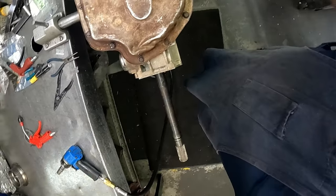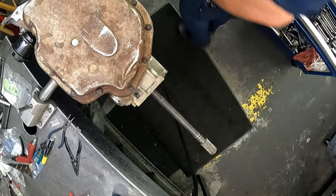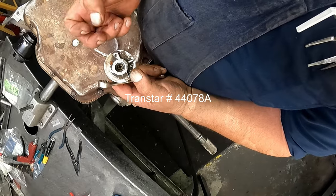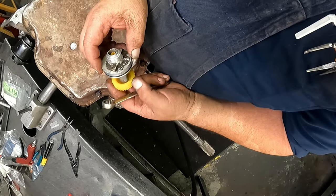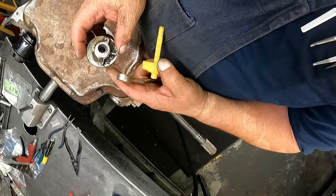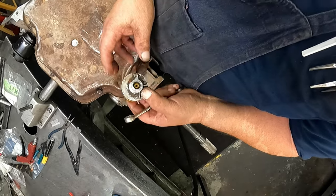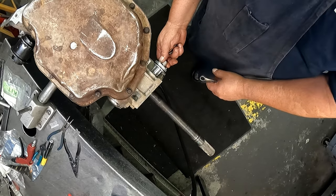We have a speedometer. There's a metal clip that holds that inner seal in there. They make a different design that presses in. It's a much better seal. I would put that in there. The O-ring here. Your housing has to match your gear, so whatever your tooth count is, this one fits a 40 through 43 tooth speedometer gears. You have to have the housing that matches, otherwise you're going to eat up gears. Go ahead and silicone this. It's going to leak also.